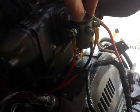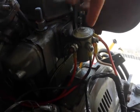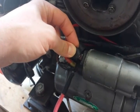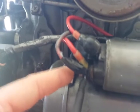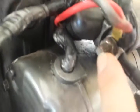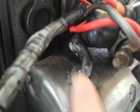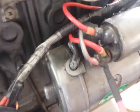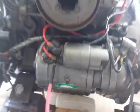What that's actually doing: the coil is closing in the relay, and it's connecting power from here to here, which then comes down and applies power here. This is the top terminal on the starter. There's another terminal down here where the battery comes in, and back underneath there's a third terminal — this is what's actually getting closed in. In addition to energizing this solenoid and pulling in the throwout, you're also jumping power from here to here into the starter. That's where your brushes are getting start power, and it's all getting commutated to drive the starter motor. As you can see, that's a pretty beefy starter — not your standard little Corolla starter — so it does draw some current.